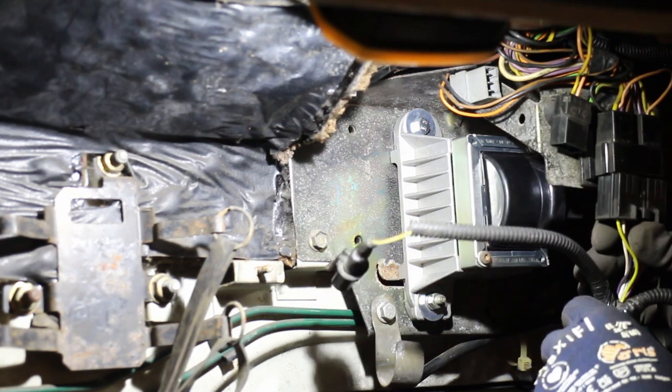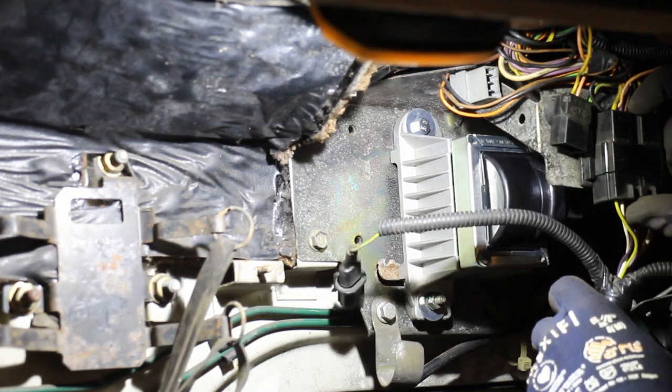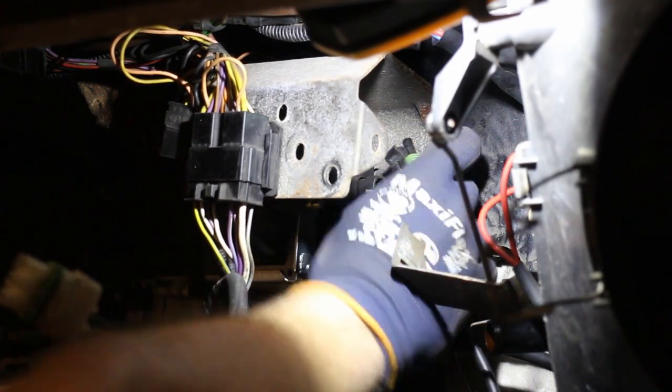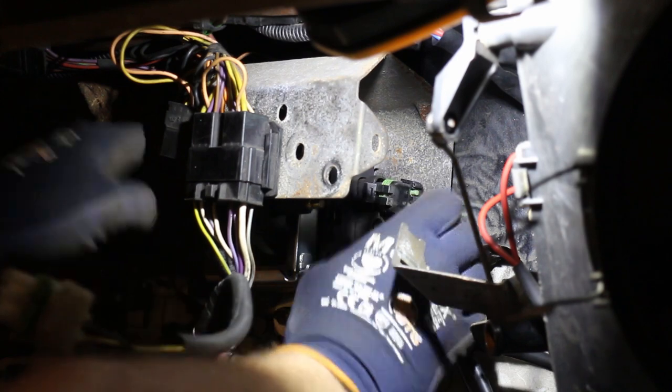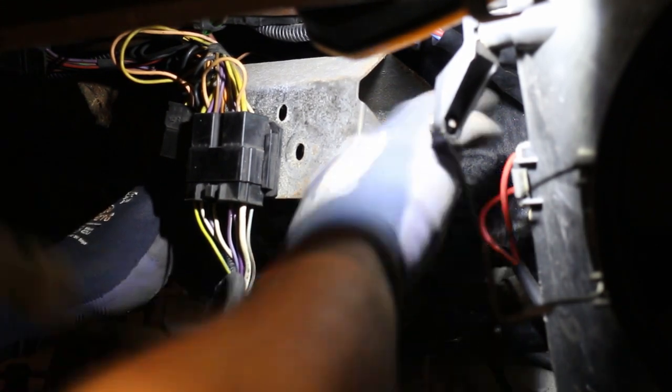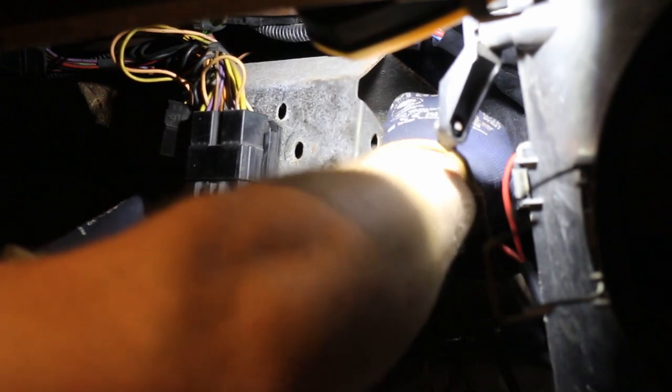The main connector can now be fitted, followed by the two on the ignition module. One's 2-pin and the other's 3-pin, so you can't get these the wrong way round. Interestingly, only 3 wires are used overall, so this module's probably used on a few other models as well, and I guess not every pin was needed on the Trafic.